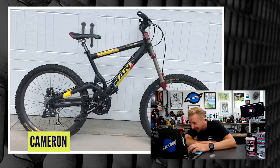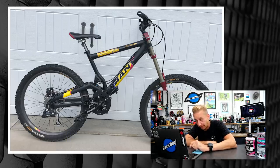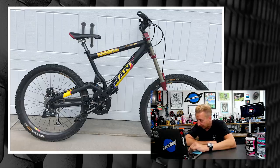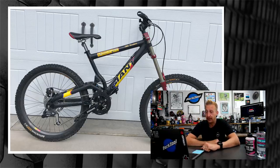Next there's another Giant — this one from Cameron in Charlotte. The geometry for this bike is surprisingly similar to what you see on modern trail and enduro bikes. Another frame raced successfully by Rob Warner. Cameron has added firmer coils in the fork and reduced travel to 170mm to ride it more like an all-mountain bike, replacing one firm coil with a medium one — ready for the bike park. Great fun for an 18-year-old bike that still has life left in it. You could put a dropper post on that and probably ride it up hills too.